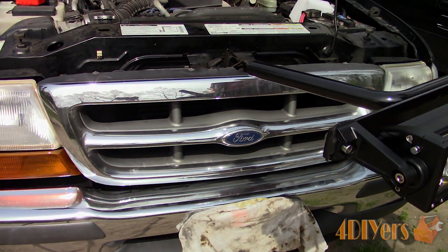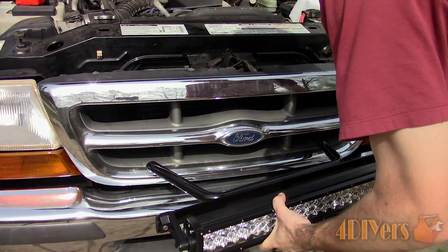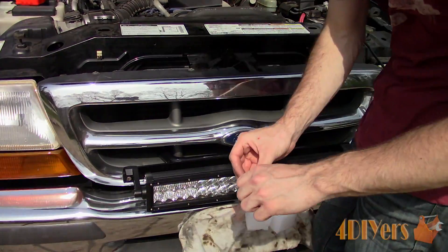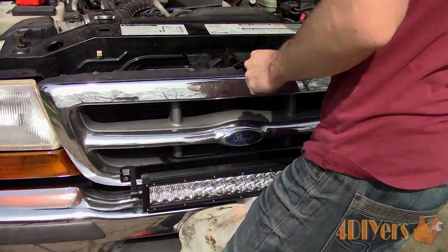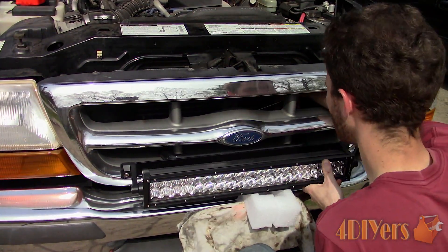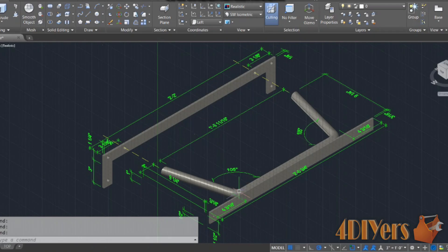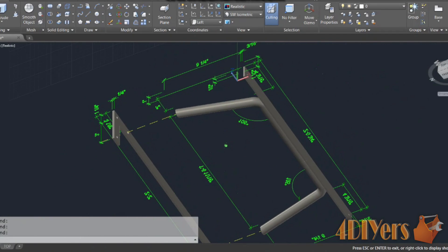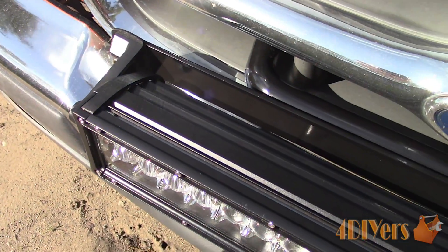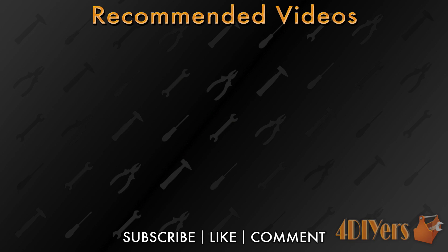Reinstall the grill and install the tube frame for the light — I have left the light on this just for personal preference. I used the foam supplied in the packaging with the light bar to hold it into place and applied thread locker to the bolts and flat washers as well. It may seem like a tight space to work with but it's not any worse than working on a starter motor — just be careful around the radiator not to damage the fins. This is a little preview of the blueprints from the light bar mount for this particular truck — I'll include the full plans on my website, link in the description below. Be sure to stay tuned for the next video on how to wire up this particular light bar. New videos are uploaded every week so subscribe by clicking the button below the video. Be sure to give me a thumbs up and if you have any comments please feel free to post them. Thank you for watching.